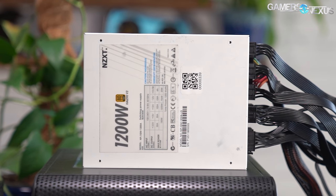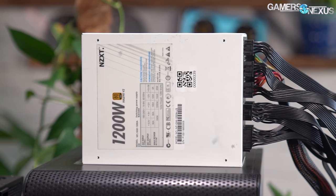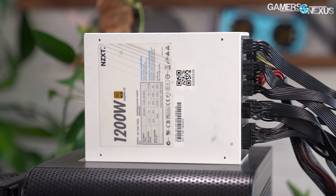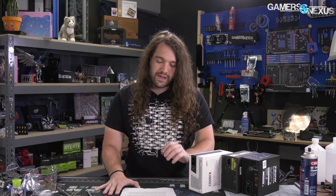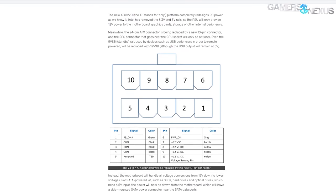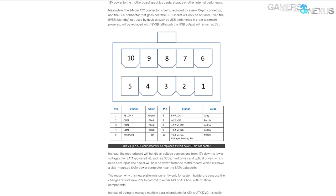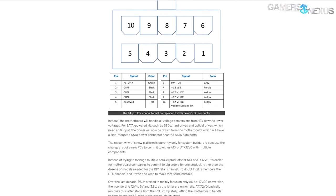In systems that have come out in the past, the motherboards are typically the ones outfitted with DC-to-DC bucks and boosts to provide the necessary power for things like drives, LEDs, and smaller peripherals. Although these have existed, they weren't really standardized and often used proprietary connectors for power supplies. The difference today is that Intel is moving to standardize these types of power supplies with 12V0, and the primary reason is to more easily meet the efficiency requirements set by government bodies.